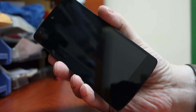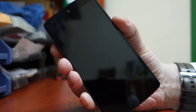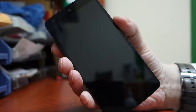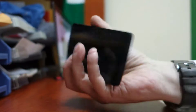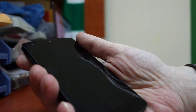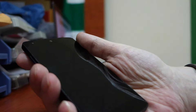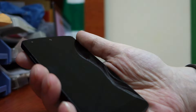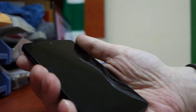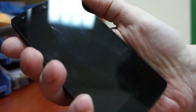It's still an excellent phone. The specs: it's got a 4.95 inch Full HD screen, a 2.3 gigahertz Qualcomm quad-core processor, 2GB of RAM, an 8 megapixel camera with optical image stabilization, and the battery is 2,300 mAh. It also has an Adreno 330 GPU and NFC — so this spec today is still pretty good.